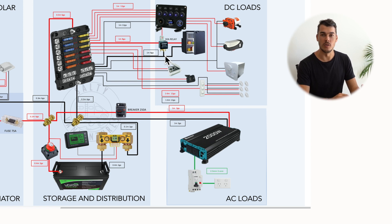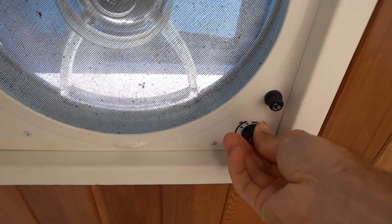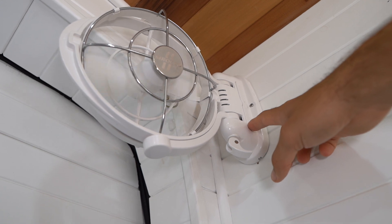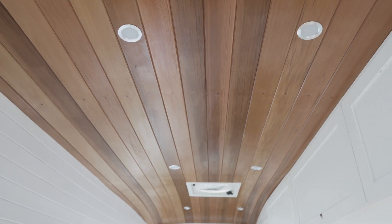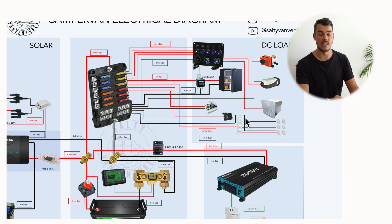Other units that have their own built-in switch don't need to go through the switch panel — for example, our roof vent fan has its own switch. The USB ports around the van also don't need to be switched off. Our roof lights — we have six of them on three different circuits: front, middle, and back — are connected together with a household three-way switch, which is quite easy to do. For the bulk of my 12 volt loads, I used a roll of 100 meters of 12 gauge wire. A lot of that was probably overkill for the current needed, but it's simpler to use one wire gauge bought in bulk rather than trying to match the most precise wire gauge to every amperage.